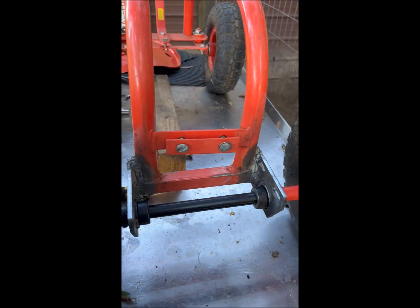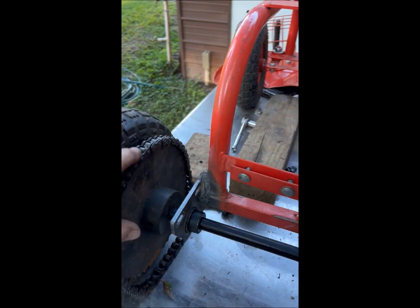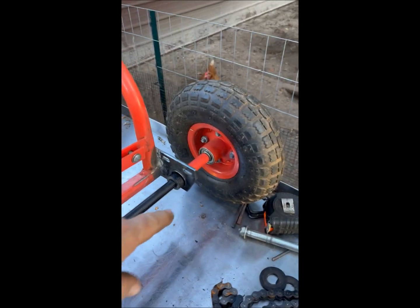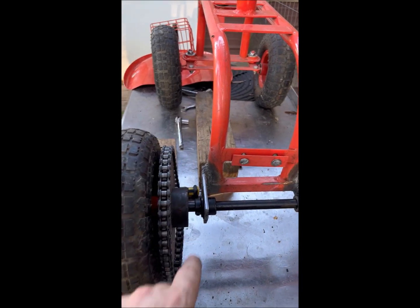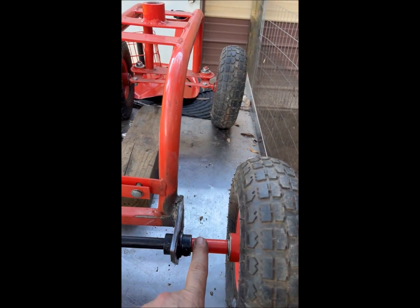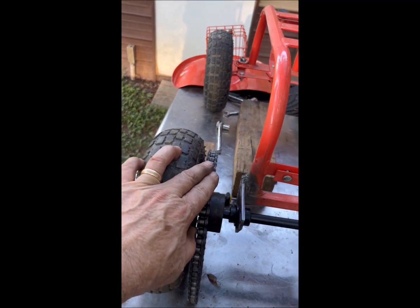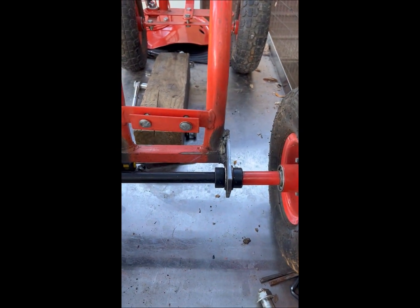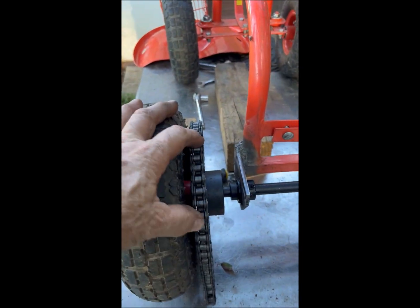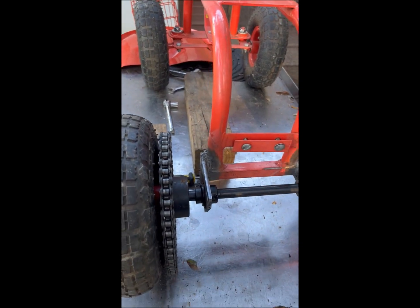This is the live axle. I got a jack shaft that came with this mounting and welded it to the frame. I can shift this over and line everything up when the engine gets put in. I'll put a caliper and disc brake on this, and that'll stop both wheels — this sprocket drives both wheels. I have a really low ratio here so she should accelerate really well, and with just a three horsepower engine it won't have much top speed. I don't want to go fast on this thing.